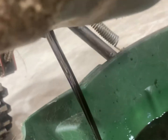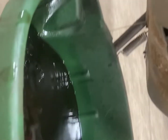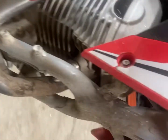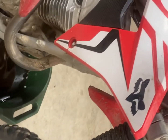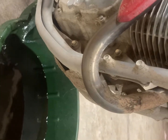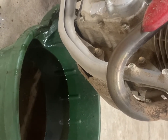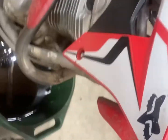Oh there we go, holy cow. Now you let the oil drain. The oil is just finishing up draining. Sometimes if it helps you, you can take the bike and lean it to the side, put it straight up and down and some more comes out of there - shake it and just a bunch of little stuff like that. Then next we're going to do the oil filter.